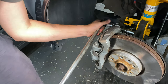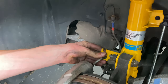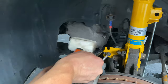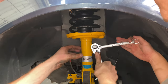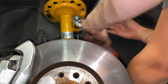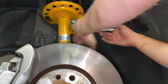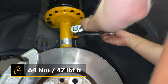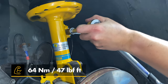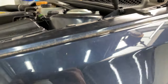This bolt stress is by design, but means it's not recommended to reuse these bolts — though I did, as is often seen on YouTube. Buying new ones is the preferred way. Reattach the wheel speed sensor bracket with the 10mm bolt and put the brake hose back with the retaining clip. Reinstall or replace the sway bar end link torquing both nuts to 64 Newton meters. After repeating the entire process on the other side and triple-checking all bolts, the front suspension overhaul is complete.